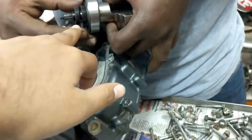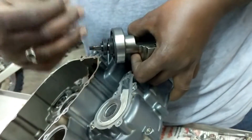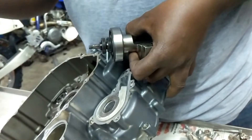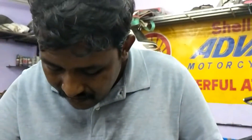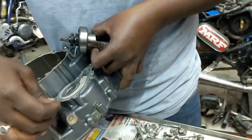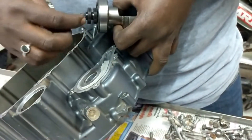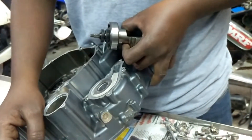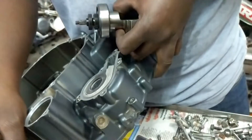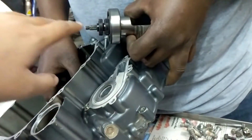So there is no plan B as such. The other bikes — premium manufacturers like Honda, even in the 1000cc bikes — they give you one outlet hole. If the oil seal is broken, the fluid comes outside. That's the difference: they're not entirely dependent on the quality of these seals.